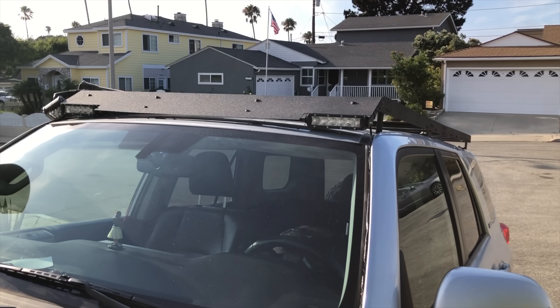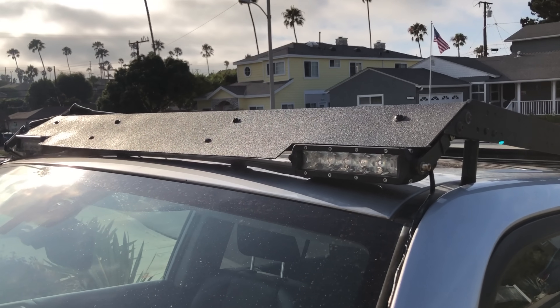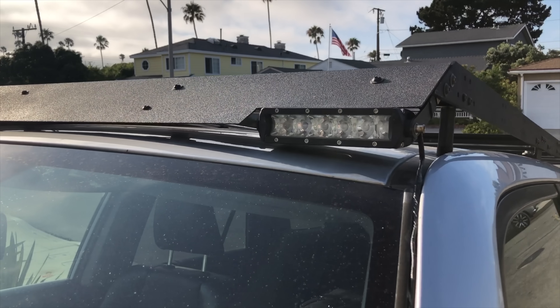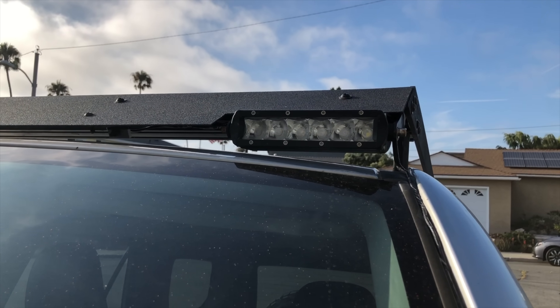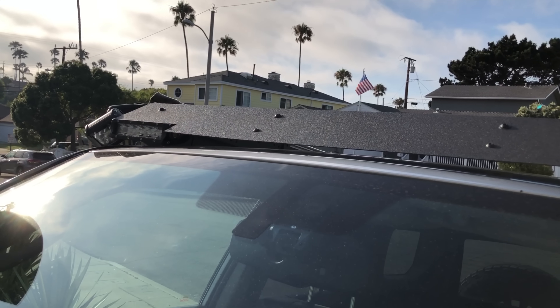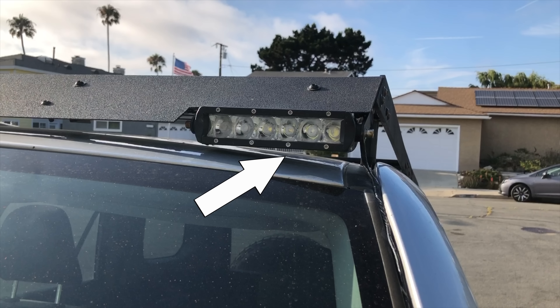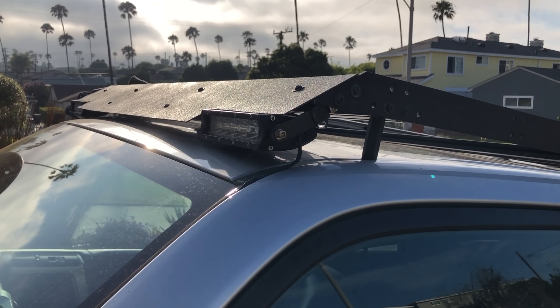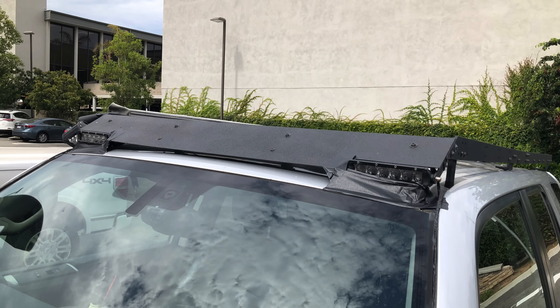As a side note, the aero shield on these things is actually partly for wind noise. After I built this, I drove it around and noticed a really loud whistling noise. Fortunately I work for a car company, and when the aerodynamicist was making fun of me for my un-aerodynamic vehicle, I asked him about the whistling. He suggested it was probably the gap between the lights and the roof — the top of the windshield, especially near the edges, is very sensitive to disturbances. I did some gorilla engineering with painter's tape and found out he was totally right. Keep this in mind when designing your aero shield.